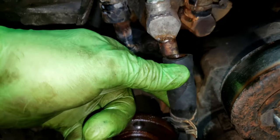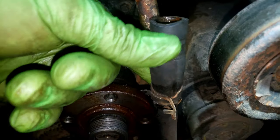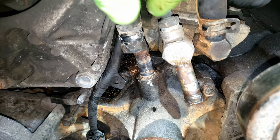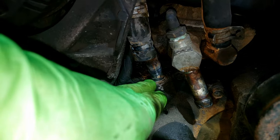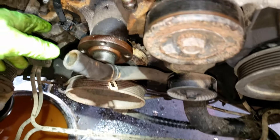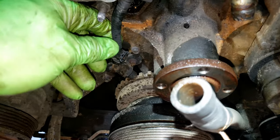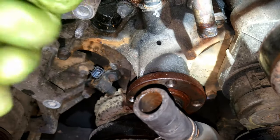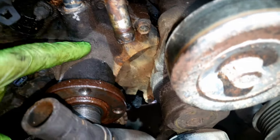Now take your couple of small hoses off by removing those clamps and sliding them off. I found on this one it's easy to use a long pry bar and just kind of pry up. Just make sure you don't damage anything on this radiator — it's not a bad idea to cover it with cardboard when you're working. You also have a crank sensor down here, so remove that and you'll have plenty of access except for the right side of the pump.